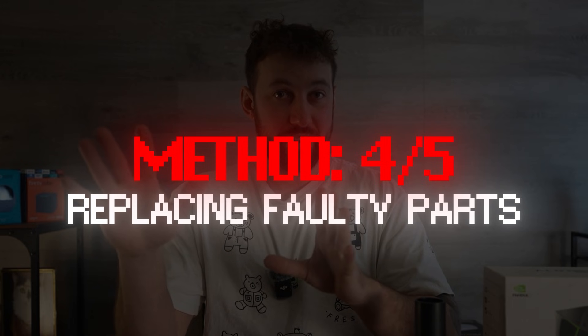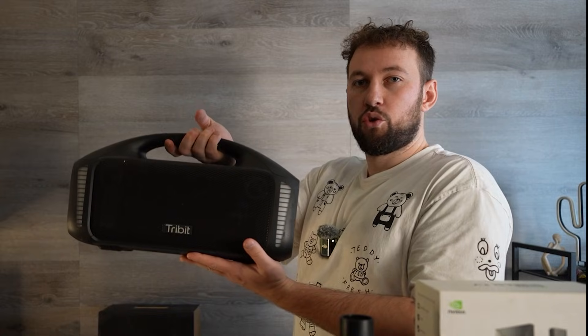I always try to leave the options that cost money for last, and that's what I've done here, because there might be a few parts of your Nvidia Shield that are just broken. For instance, if your device is not powering on at all, it could just be your power cord, or you could have a faulty HDMI. If you have another HDMI cable and another power cord at home that fit your Nvidia Shield — it's a pretty common connector, even this Tribit speaker uses the same sort of power cord — swap it out and see if it powers on and connects. If you don't have one, I've included links down below in the description.